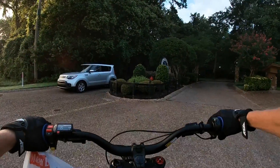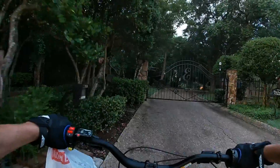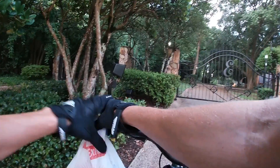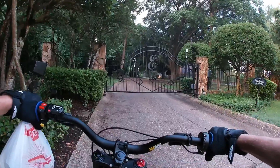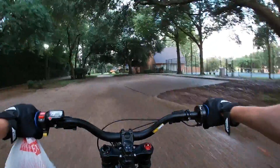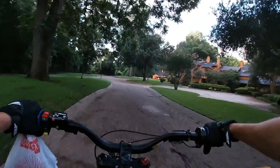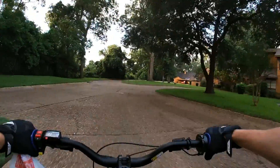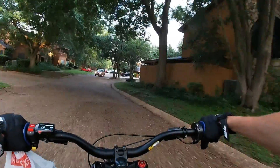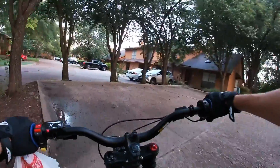When you get this bike, when it says you're doing 25 you're really doing about 20, when it says 30 you're doing 25 — it's about five miles per hour off. I use a GPS app which is very accurate, tested it in my car. Now that I put the golden boys on there I'm only reading about one to two miles per hour slower than my speedometer says. You can't change the speedometer on the bike — it reads off the motor.